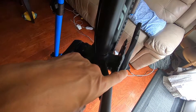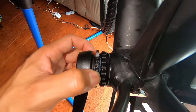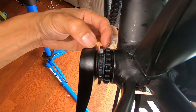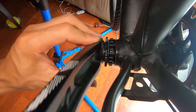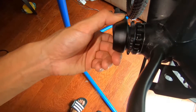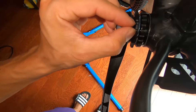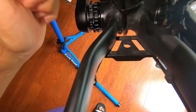That's what this little thing right here is for — it's a preload adjuster. It's basically a little dial that spins. You rotate it clockwise and it expands, taking the slack out of the system so there's no play. After you rotate it clockwise to get it as tight as you want and remove all the play, there's a little spot right there — a 2mm hex key — you just tighten that down, it closes that gap and keeps the adjuster in place. That's all I did to get the cranks on.